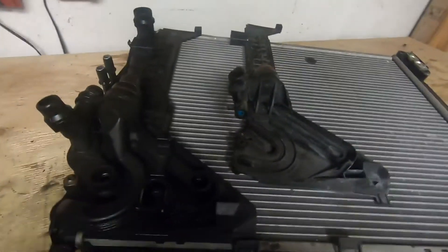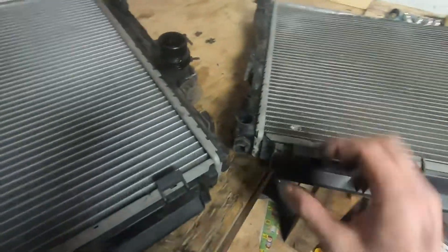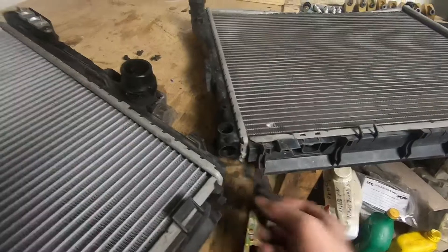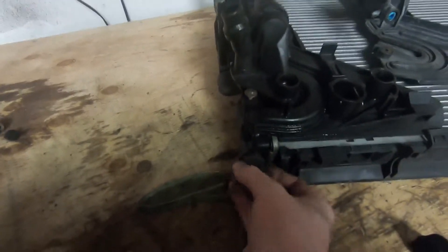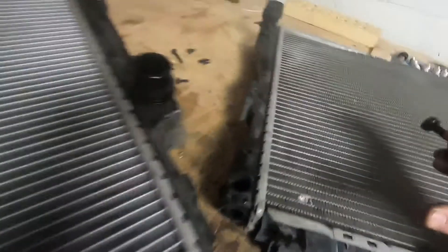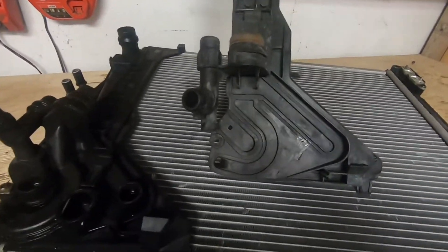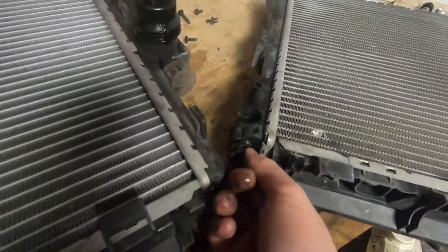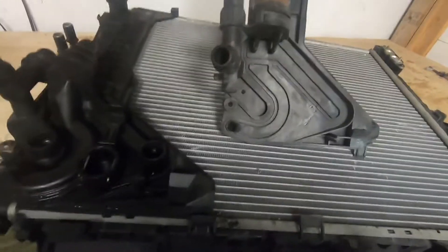The only other thing you need to use is the drain plug — I'll show you the difference between the drain plugs. This one on the automatic is just a small little plug, whereas the manual one has a shaft on it with a seal. I'm actually dripping coolant everywhere now. What that seal does — let me just stop the coolant flow — is this hole on the automatic rad, without this drain plug, would flow coolant out towards where the trans cooler sits. This will seal right above that, so no coolant will flow. As you see on the manual, they call this the expansion tank mounting bracket. I'm going to put the part numbers for these in the description. You can see there's a hole there, and if you didn't have the shaft on here it would just leak coolant out here constantly because it's open. So that's all it really is.